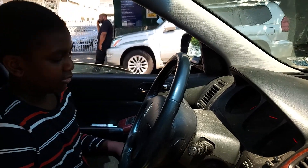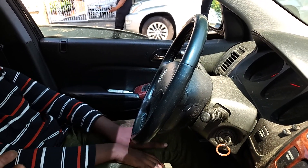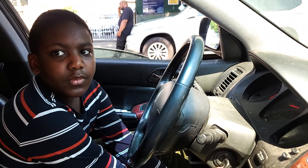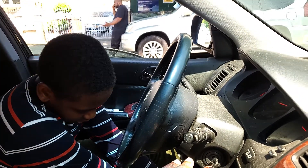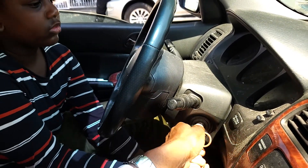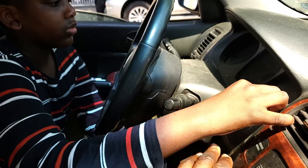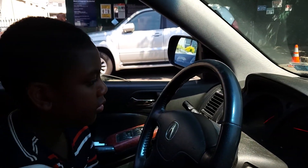The maintenance required light is for when it's time to change the oil, do the timing belt, and maintain your car — preventive maintenance. As soon as you change your oil and everything is okay, you check with your technician. Turn the key off, push your hand here, hold it, turn the key on, and wait till the light goes off. This is only for this car. You already reset it — you cannot reset it two times.